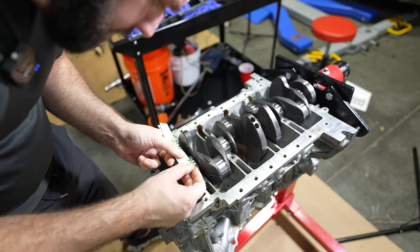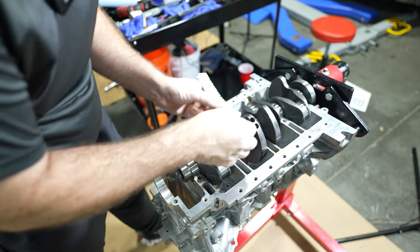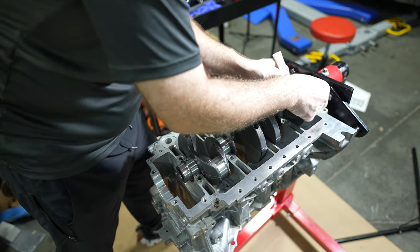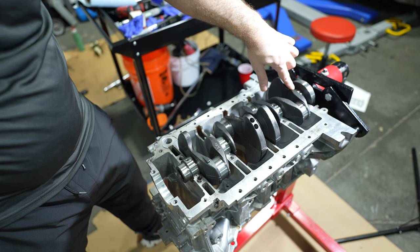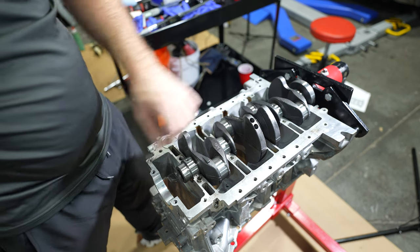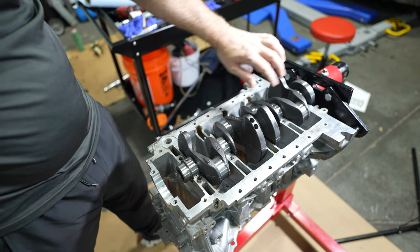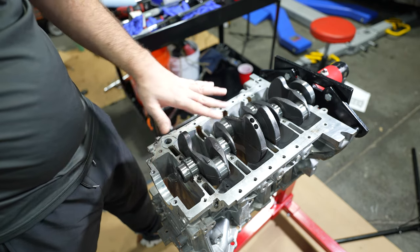So this is probably a 0.030, maybe 0.032, similar 0.032, 0.030. This one is less than 0.025, it's probably a 0.024, which is in spec. Spec would be 0.020 to 0.042 or 0.047, I believe. When I did the clearances on my X3, they were all over, but then I dialed them in to be around 0.027, 0.028. 0.030 would be ideal technically.